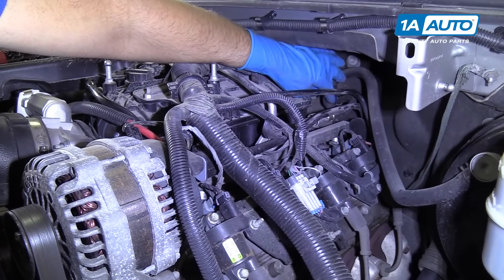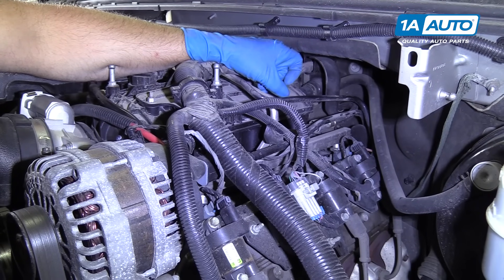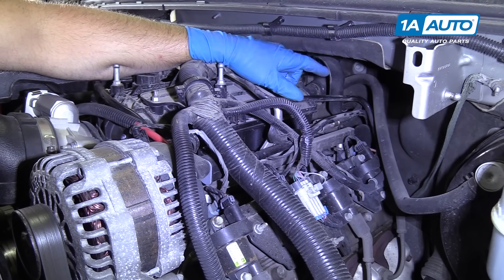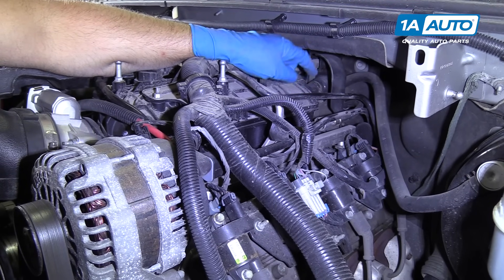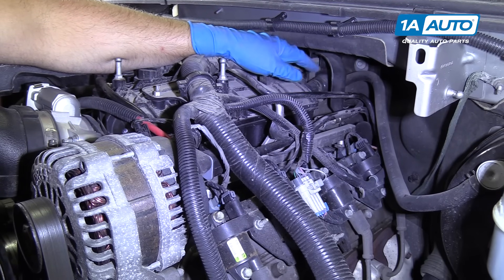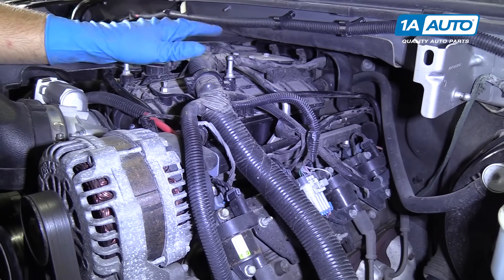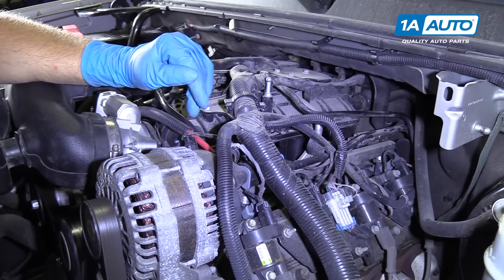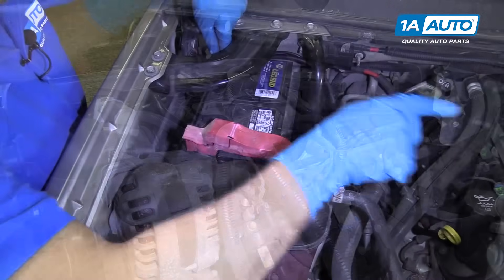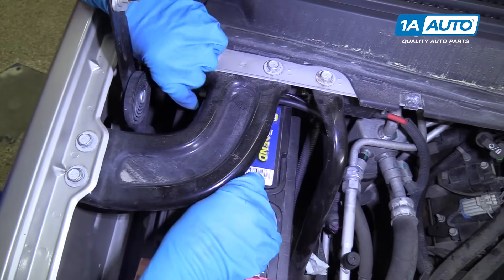It's really hard to get to. You can struggle to try to get that connector off — you'd have to pull the lock tab up a little bit, then squeeze the lock on the connector and pull the connector off. If your oil pressure was stuck at 80 and when you did that it dropped to zero, then that's 100% the oil pressure sensor that needs to be replaced because it's shorted internally. We are going to remove the intake so that we can show it on video a lot better. Because we're going to be disconnecting the wire to the alternator, we're going to disconnect the battery so we don't arc anything out.